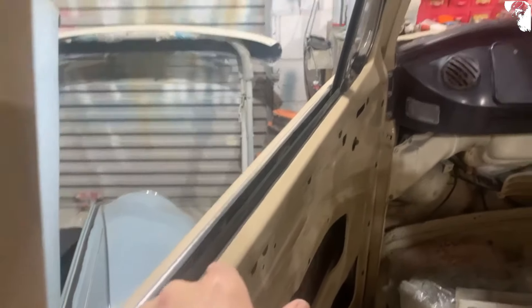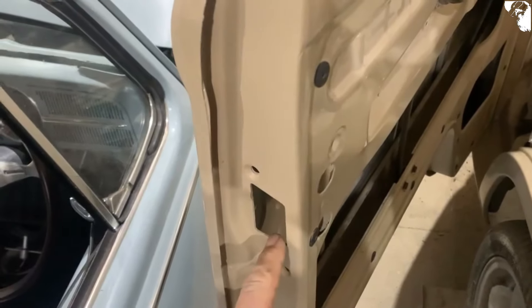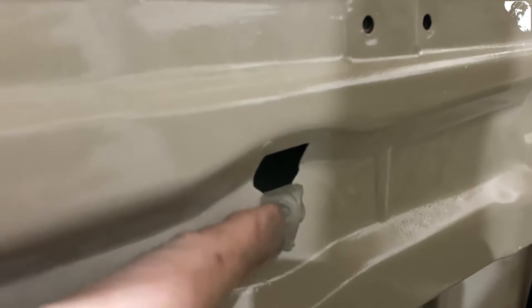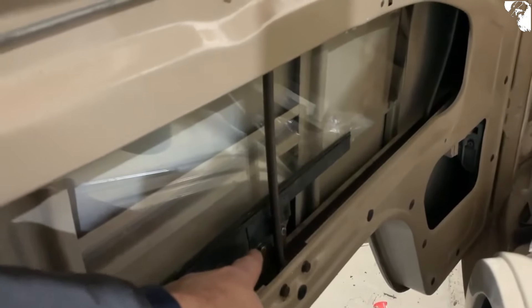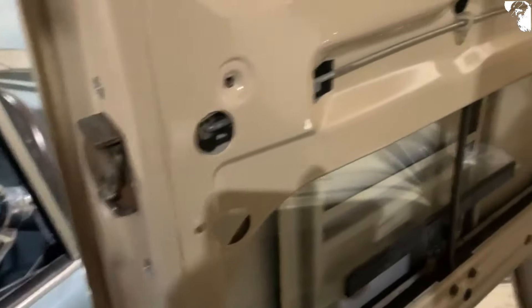Now this inner seal is shocking — I've even got to finish punching the holes all the way through it. I'm going to use the old wire because that shape looks like it's going to be very troublesome getting it in. That's pretty much in, just a little bit of trouble with this end clip, but I'll get it. That's the quarter light. So far the order of putting the door back together has been: window regulator, door glass, outer scraper with the chrome trim, inner scraper, quarter light.